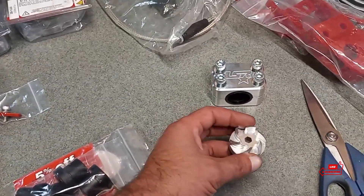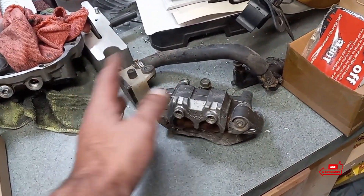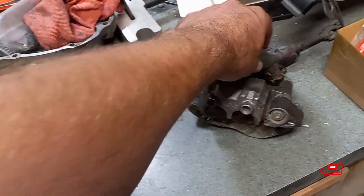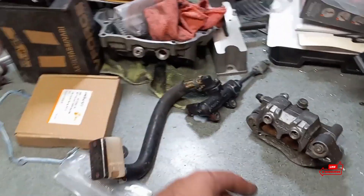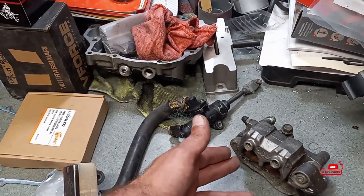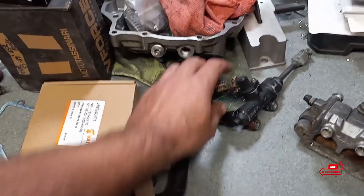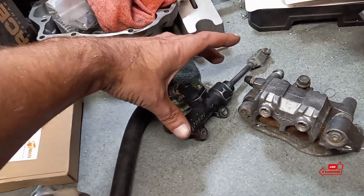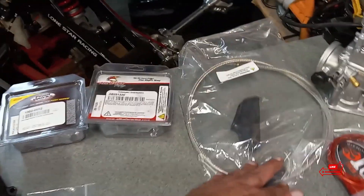Next thing we got — I got a billet water pump impeller and I have the full rebuild kit for the water pump too. The stuff you guys just seen, brake stay and all that. I have a whole other rear brake setup here — so I'm going to rebuild this one and powder coat it and all that good stuff. Also going to upgrade the reservoir for the rear. I think I'm going to order the master cylinder — the one where the reservoir is actually part of the master. They're a little pricey, but it deletes all this extra stuff and just makes it a lot simpler.